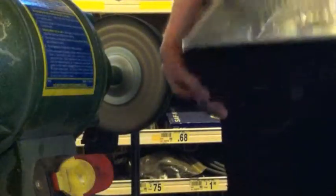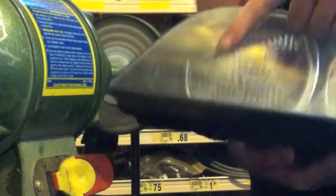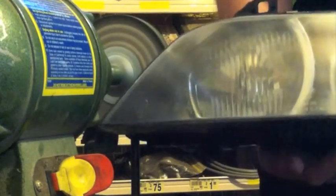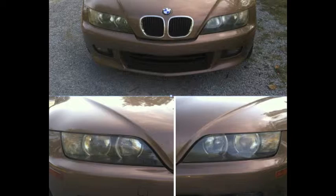Just to keep from beating a dead horse — you can already see where it was before versus after I've been buffing on it. I'm not totally done but I'll keep buffing. Here's what the headlight looked like before I sanded it — I tried toothpaste and headlight restoration kits with not much luck. Here's what they look like after being sanded and buffed: they look great. They may not look as good as brand new headlights, but especially if you live somewhere dusty like I do, they look as good as new for all practical purposes. I'll put up a link to a video of the entire buffing process — thanks for watching.